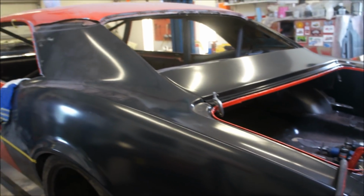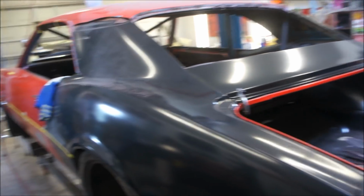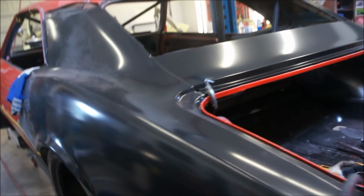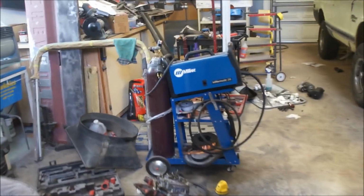And not just a little bit of guide coat, because I learned that from Matt, Shut Your Face Garage. You really want that panel black against a gray background or whatever primer you're using. You want an off color that's really going to show every little scratch, every little ding, all that stuff. Because just a light coat of that, you can miss stuff. So I'm just telling you, if you want it glass, if you don't want it glass, then do what you do.